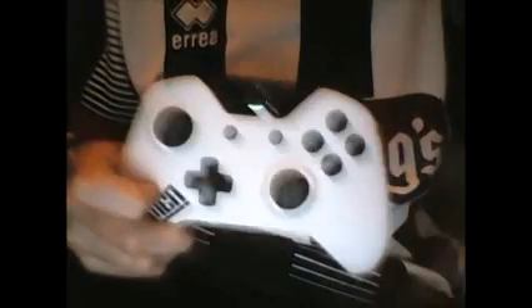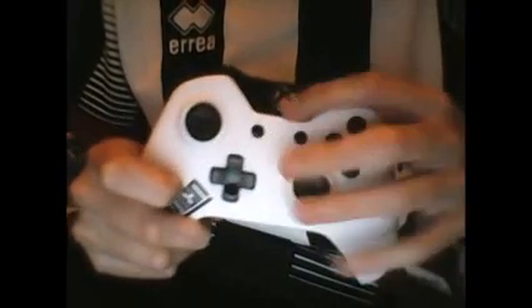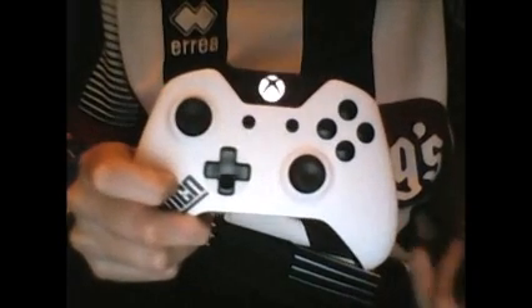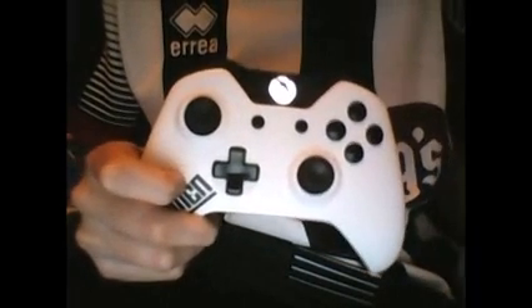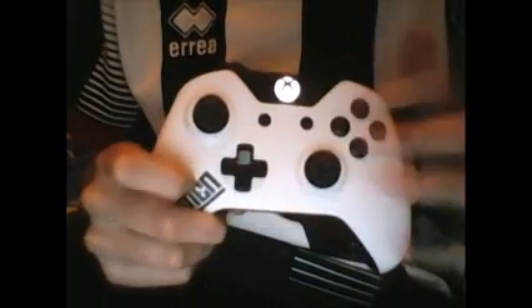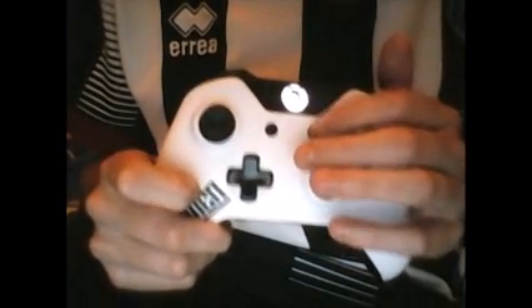So you do this next trick with just your controller. Obviously it needs to be turned on, which I'll turn on now. So your controller's now turned on and you've still got the green screen of death. You want to hold your controller until it vibrates — like you just heard — and then click the start button, or the button that has three lines on it.